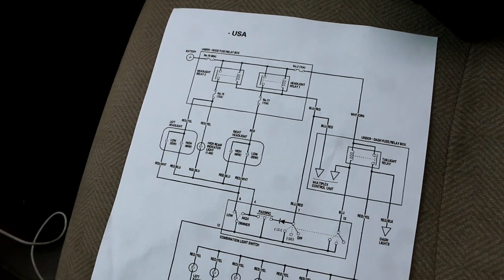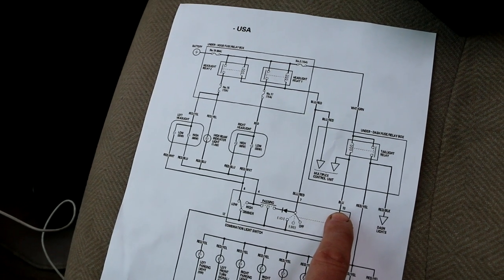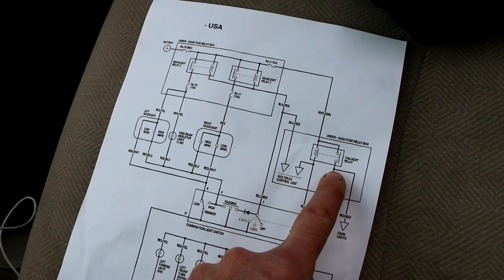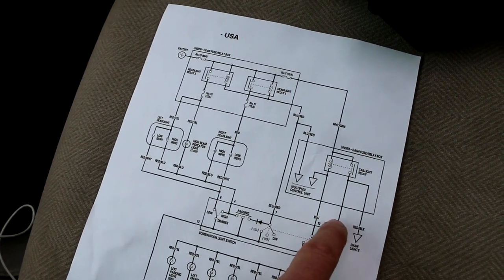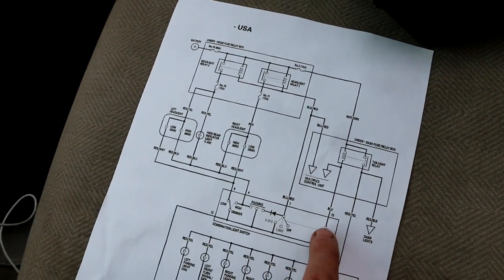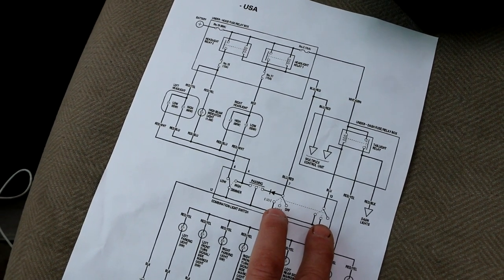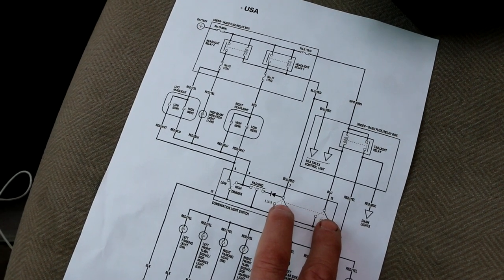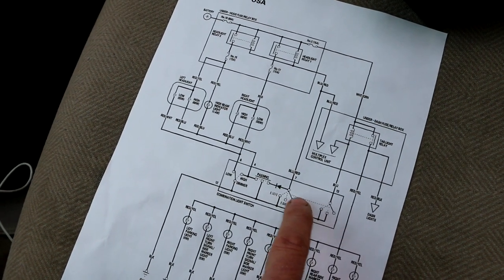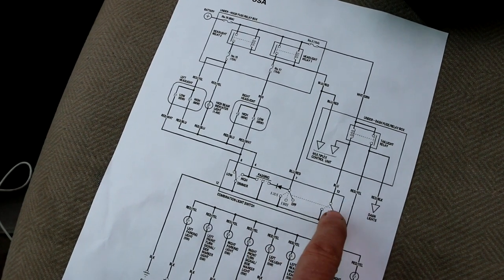Actually, technically, only 4 connections to the headlights, because 13 actually energizes the relay for the taillight circuit, okay? So if your taillights aren't working, you're going to be looking at a problem probably in this circuit, or it could still be a switch issue, because the way this switch is made, there are 2 switches here that are mechanically together, so that's what this dotted line represents, so that when you turn the switch on, you actually are closing 2 switches.